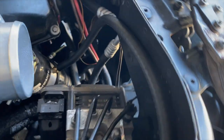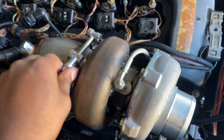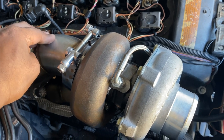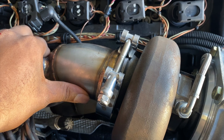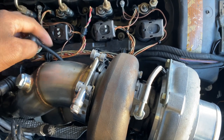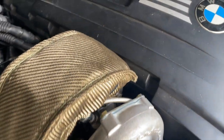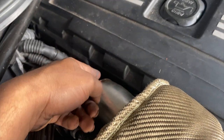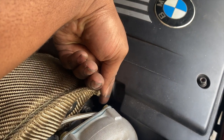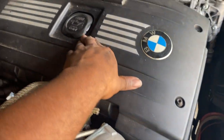Everything's secured. Now I just need to tighten up the turbo, keep it from swiveling, and get it at an angle I like for downpipe clearance, then start fitting the downpipe to the OEM exhaust. I'm also taking the whole harness off to reroute the wires away from the heat — they're not touching anything but I want them clear. I'm going to mark and trim the engine cover right here to give the downpipe room, cutting out a little square so the top cover sits flush.